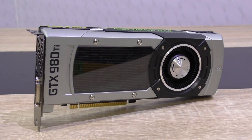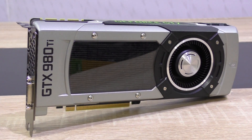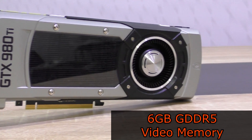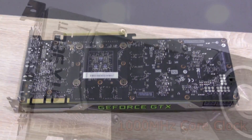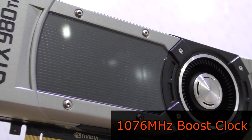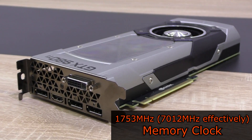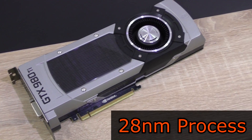This is the reference design of the NVIDIA GTX 980 Ti, so no overclocks are made here whatsoever. The GTX 980 Ti makes use of the immensely powerful GM200 GPU and is equipped with 6 GB of GDDR5 video memory with a 384-bit bus width. The base clock is at 1000 MHz, the boost at 1076 MHz, and the memory is clocked at 1753 MHz — 7012 MHz effectively. The TDP is 250 watts, and the GPU is manufactured on the 28nm process.